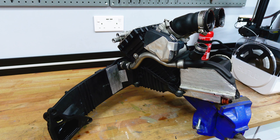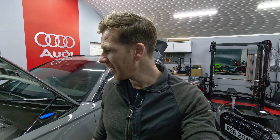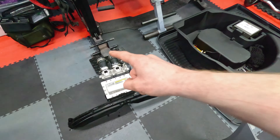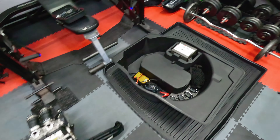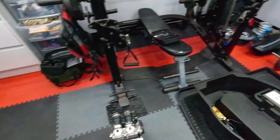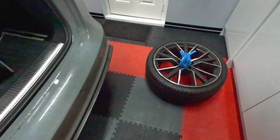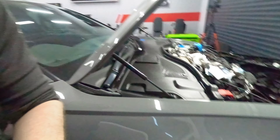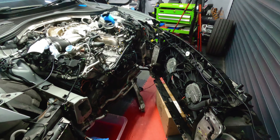Here's the actual unit on the bench — quite the ordeal to remove it. This is the intercooler, or charge cooler, at the top, and this is the throttle body housing. But attached to it is the actual oil separator — the positive crankcase ventilation unit. Not the PCV or PVC that I keep saying throughout the video — it's definitely not PVC, that's just for the weekends! So this is what we're going to be changing. We've got a brand new one here from Audi and a few other Audi goodies we'll go through in the next video.